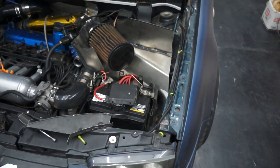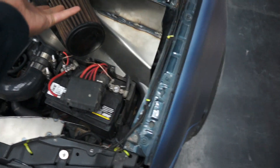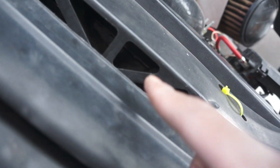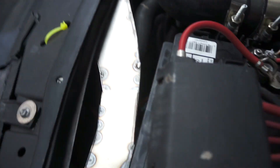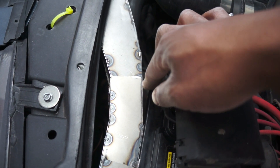I'm gonna direct it along this bottom piece and it'll just fill up this entire area with cooler air. The most important point of this system is just to get clean air going into the air filter instead of using the air radiating off the engine. I did get the inlet here — everything is in, it's got a little scoop in there as well, so it makes a really wide mouth and then narrows down into like a three-quarter inch thick piece. I just tacked it on the inside — you can see all the little penetration marks where I tacked it.